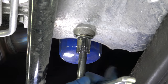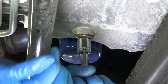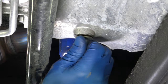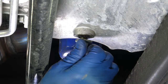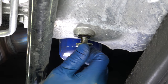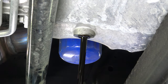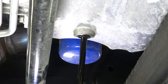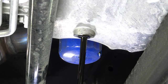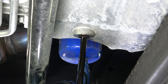What you need to do first is to remove the oil drain plug. You can do this part by hand. Just be sure that the oil drain catch pan is below the drain plug. Now we'll go ahead and let that totally drain out, then I'll go get my oil filter wrench and go ahead and remove the oil filter.